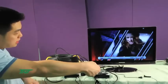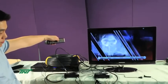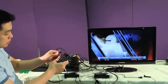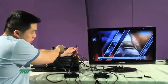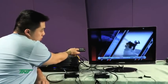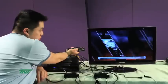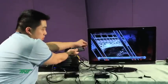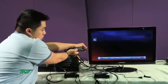Right now you see it working here — if the remote goes straight to the TV, it works, but if I put the remote control back here, there's no signal at all. This is where the IR function comes in. With the IR sensors from the receiver placed back here, it actually does work. Without the IR sensor, trying to mute — it doesn't work. With the IR sensor back here, it works. Without — doesn't work. With — it works.